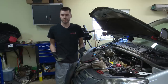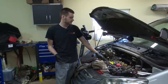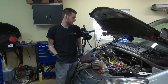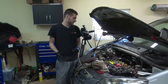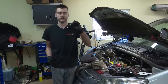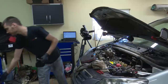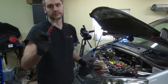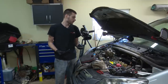All of our valves are now adjusted. Interestingly, intake valves were all in spec at 8 to 9 thousandths. Exhaust valves, on the other hand, were definitely out of spec. Cylinder head number two — the front head containing cylinders 4, 5, and 6 — seemed tighter than the rear head towards the firewall containing cylinders 1, 2, and 3. There could also be some difference based on cylinder head design and how it feels overall. You're going to want a good set of feeler gauges. A feeler gauge with a 90-degree angle might be easier to use, especially for the exhaust valves.